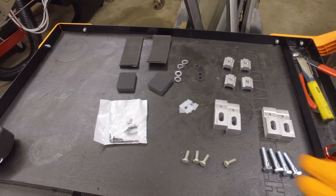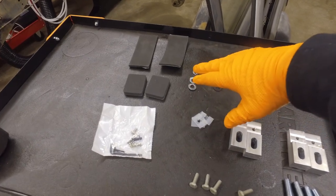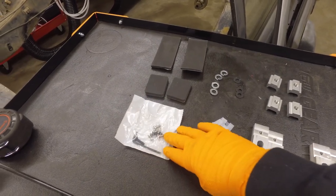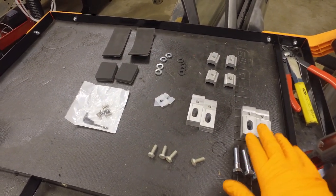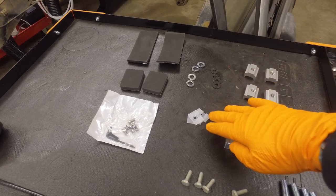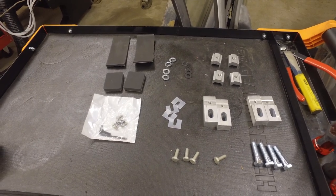Here are some of the pieces that came with the kit: a wide variety of screws, nuts, bolts, and some foam. These foam pieces will be installed first as weather stripping — they go on the base of the retract so it doesn't rub or vibrate against your bed. There are also miscellaneous nuts, bolts, and an Allen wrench provided. Some bolts go in the track, others assemble the retract to the track system inside the Tacoma using the washers. Shims are provided so if something's out of alignment you can use them to get everything straight so the retract system glides smoothly open and closed.